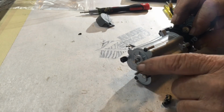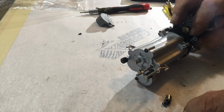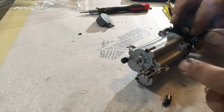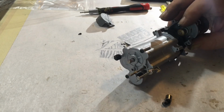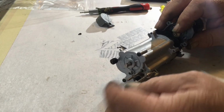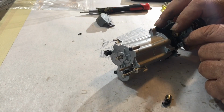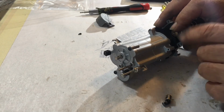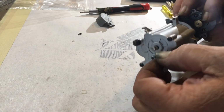I've had to actually make servo arms for these things. They come with a servo saver from the factory, and I've always gotten rid of the servo saver, because the spring expands out on them and stretches. I've just put a servo arm on there, and sometimes I've slotted a hole in it just a little bit back so it has the perfect throw back and forth.